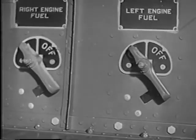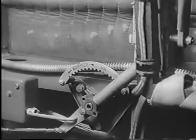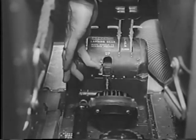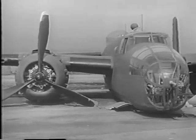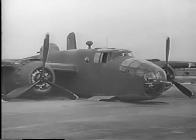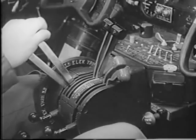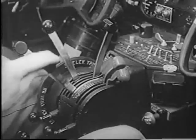Wing flaps come down 15 degrees for normal takeoff. Control neutral. Cowl flaps open. Emergency brake control: safety. Emergency hydraulic selector valve: normal. Fuel emergency shutoff valves: on. Set your cockpit and compartment heaters off — they're the combustible type, unsafe to use during takeoff. See that your static pressure selector handle is set at normal, and your gyro instruments uncaged. While you're on the ground, never release the landing gear safety lock or throw the safety latch. If you do, the landing gear lever might accidentally be lifted, and a B-25 is not designed for digging tunnels. Someone's carelessness in securing the safety lock and latch made this ridiculous accident possible. Propellers cost money — you can't throw them away like matches.